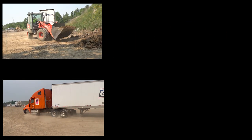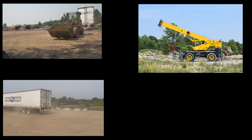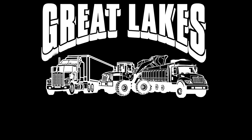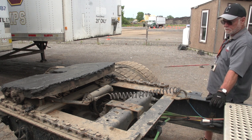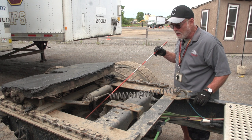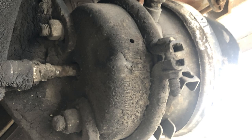Let's get started. Now our back tractor brake system — the back tires. We start with our brake lines or brake hoses; they're secure, they're not cracked or leaking. They go into our brake chambers — both sides — they're secure, not cracked or leaking. I don't see any dents or bends in this brake chamber.